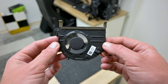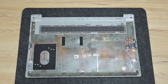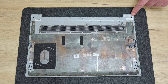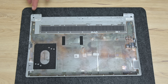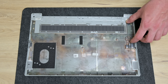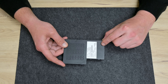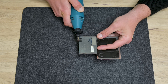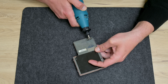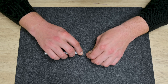The cooling is like new. Now let's move to the bottom case. The bottom case is broken at the speaker grill, and two plastics from the screws are missing. Both screws at the top are very important because they play a big role in the hinge and durability. Because both are missing, I use plastic from some other laptop. Using a Dremel, I cut the part, and later using a scalpel I made some adjustments.